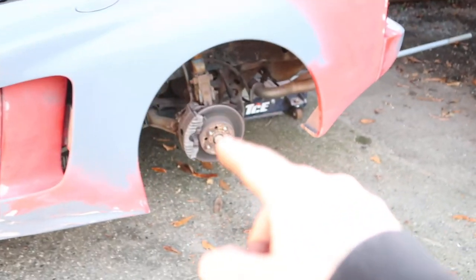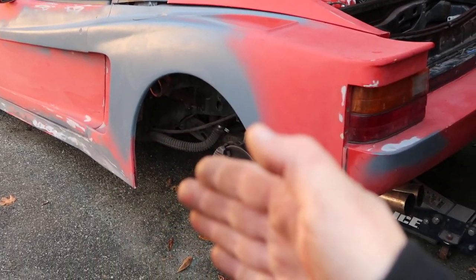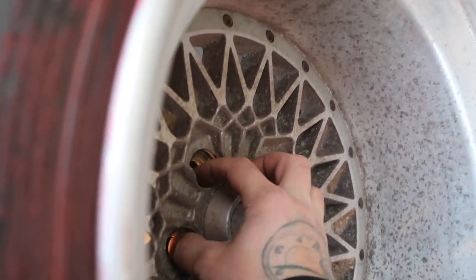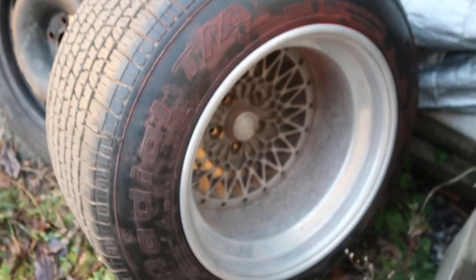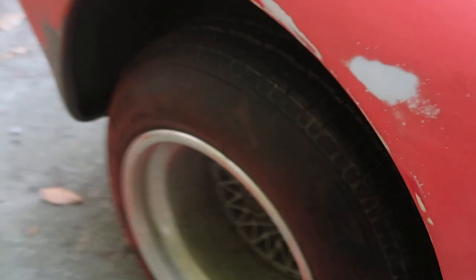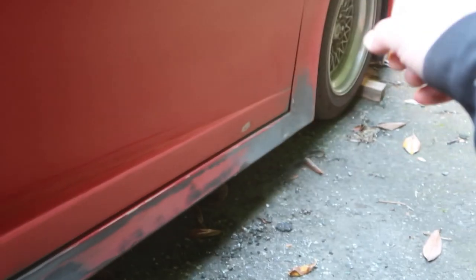For all you guys saying go ahead and do some aftermarket rims — the downside of doing aftermarket rims on this car, on the Fiero, because the bodies are so much wider, is that you've got to have deep dish. If you don't have that offset you're gonna have to run wheel spacers, because your center hub is so far out. The nice thing about having a stretched rim or deep dish is that you don't have to run crazy wheel spacers. The other option would be to spend the money and get a custom wide-track suspension, but I don't want to go down that route. So I'm gonna rock these rims — they're more authentic to the stock ones. I'll do the gold centers, polish the outside, and get some wider meats on the back and new ones for the front.